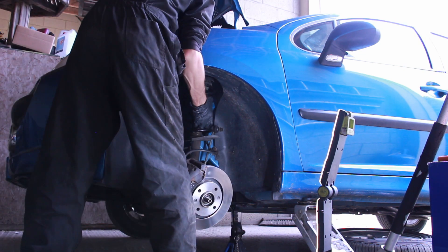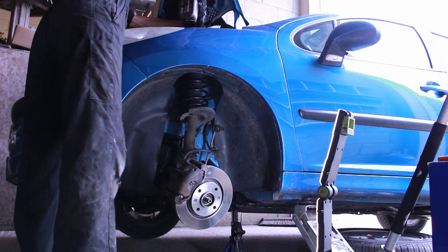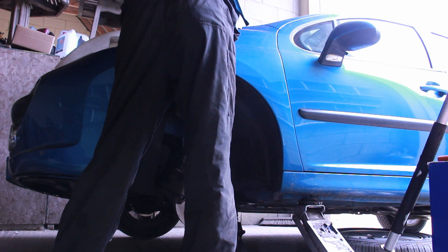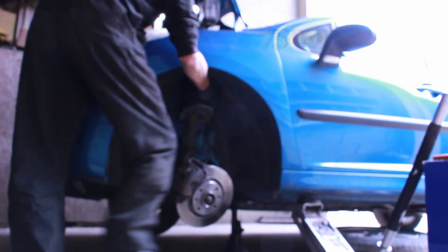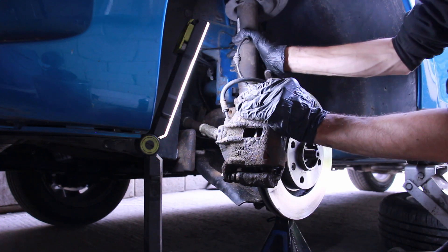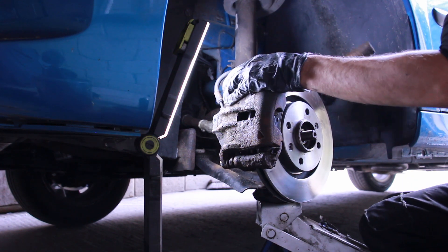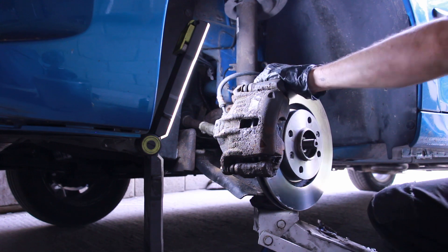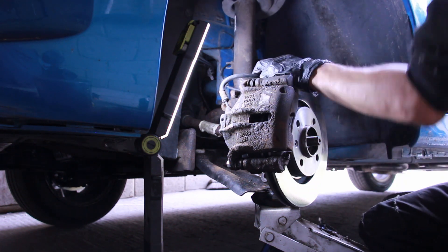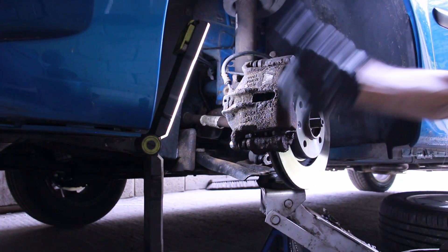Now with the strut all aligned in the correct orientation, popping it back in the car. 75 newton metres for this one, so that's what I set my gun up to. Aligning the tower up, making sure it's in its right position, giving it a wiggle and then sending it home. There's a little nubble on the back of the strut — or the damper, the shocker, whichever you want to call it — make sure it aligns with the slot in the hub. If it doesn't, give it a tap round until it does, and then as you jack up give it a little tap with a hammer and it'll slowly slide its way home. Giving it a tap round to make sure it's lined up and applying pressure with a little tap for a shock, you'll see the strut just dropping into place until it's home.